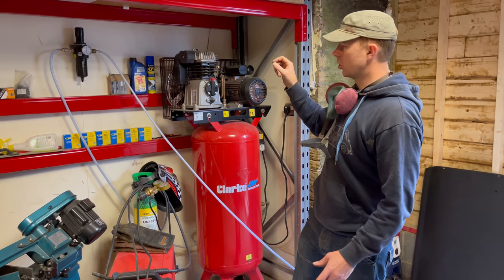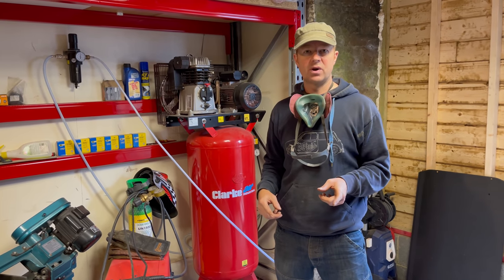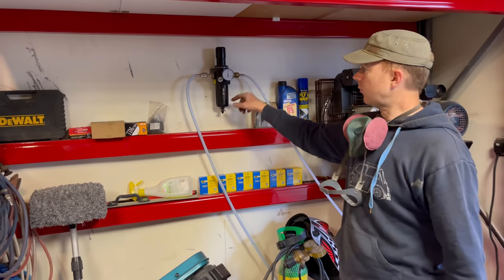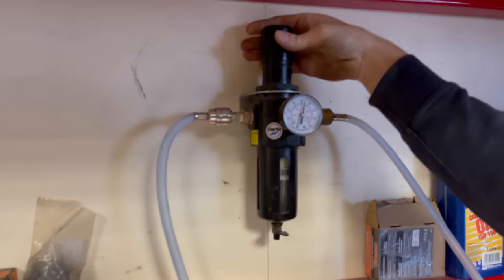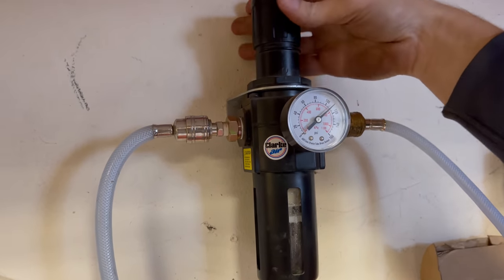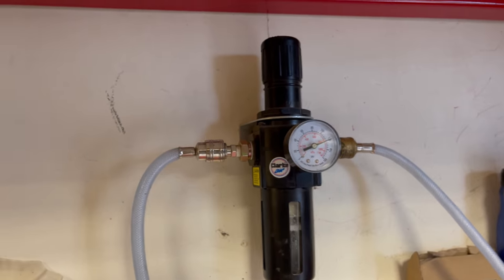And the pressure pot that we're using in the shot blasting booth we've set up in the greenhouse is a maximum 120 to 125 PSI that it'll run at with the tank. So what we've got is a regulator with a water trap, and I'll turn that up to 120 PSI. As you can see, I can raise the pressure on it. I won't go any higher, I'll leave it at 120 so it's not maxing out the pressure pot, and that's this all set up.